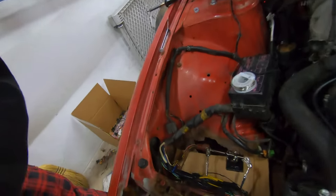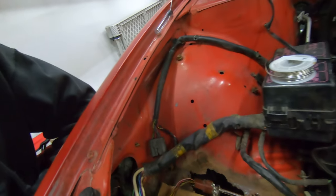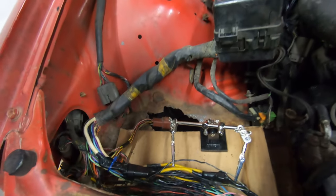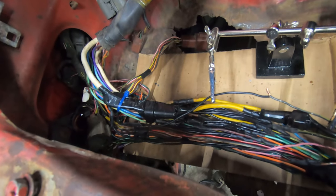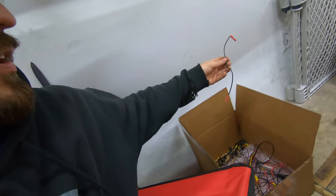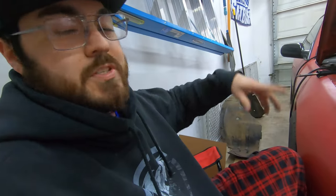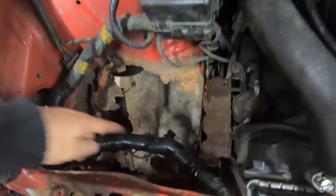Finally to the very last wire. The camera died during the time lapse yesterday; I resumed late afternoon today. It's taken many hours - about 10 minutes per wire and there's about 40 wires. Solder buddy came in clutch: twist the wires together, solder them, heat shrink. All the wires are matched up perfectly, only extended about an inch to three or four inches depending on the wire and location. Now it's all cleaned up, looks much better. I've got some sheathing to put over that to tidy it up.